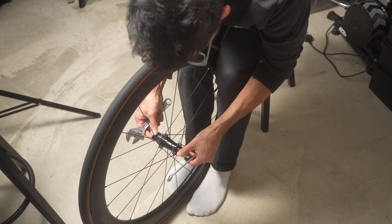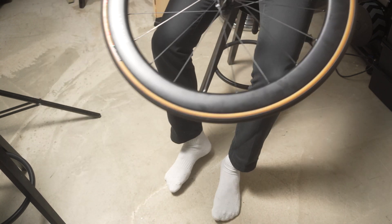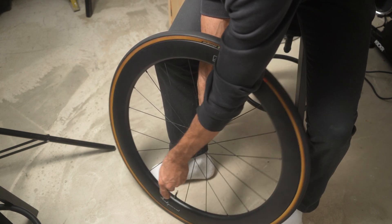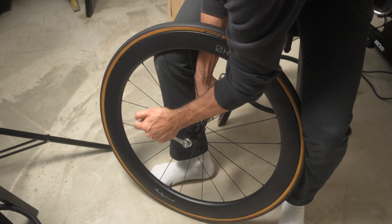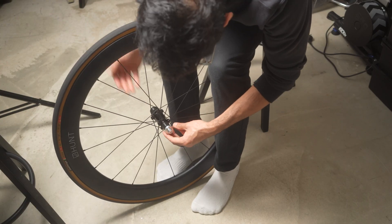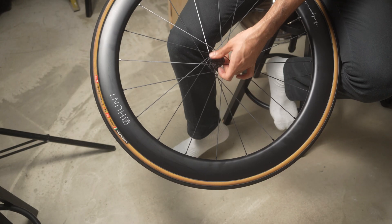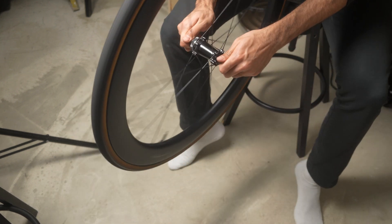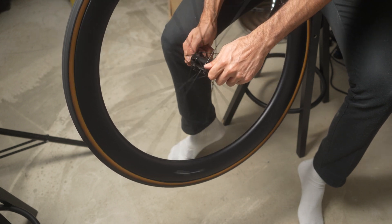It's the same process on this side, but this time you have the axle in the bike. Make sure the axle is the right way around — the longer side points towards the centre lock. This is where the 3D printed drifts began to show their limits; the plastic PLA compresses slightly, so it lacked the feedback of the bearing being pressed into its seat. Once it's all done, make sure the wheel spins smoothly. If it feels even a slight bit grindy it could mean one of the bearings isn't aligned, and if the axle is moving around it means the bearings haven't been pressed in enough.